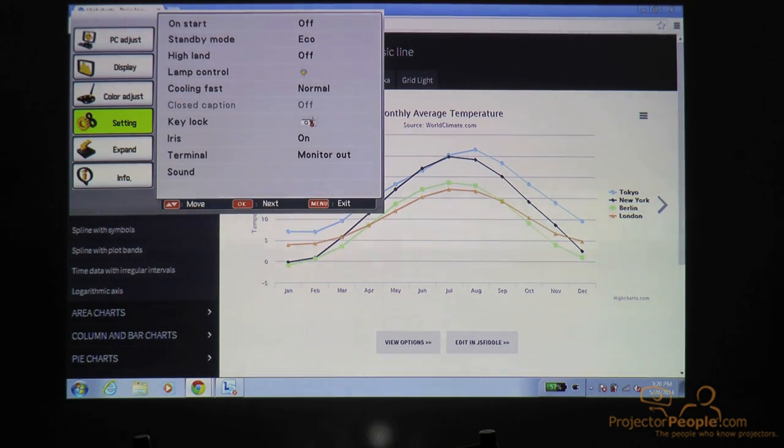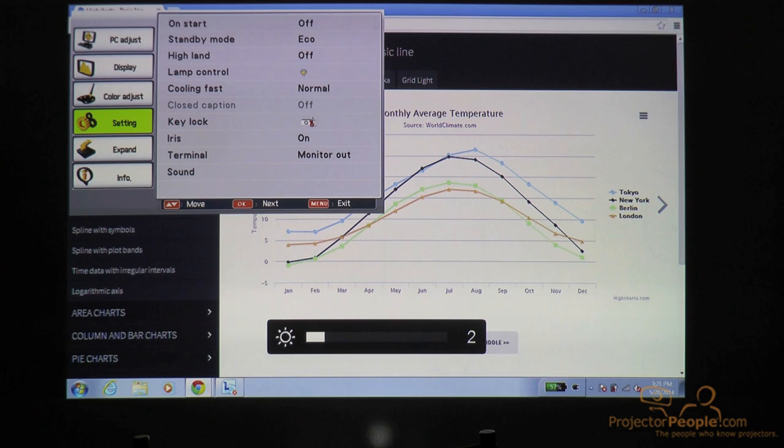You have your standard eco modes. This projector has a 6,000-hour lamp life running in eco mode, which is what we're in right now and it's totally acceptable. That translates to about three years of lamp life if you're running it 8 hours a day, 40 hours a week — making it a very cost-efficient choice for a high-use classroom or business environment. It's kicking out 3,000 lumens right now, which in a short throw projector is more than enough — in a standard throw projector you'd need more, but at this close distance 3,000 lumens is excellent.